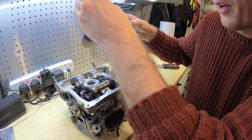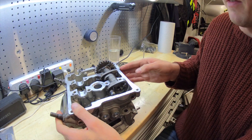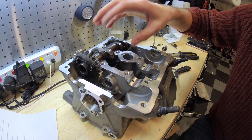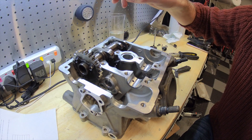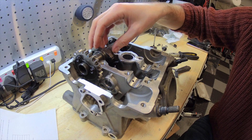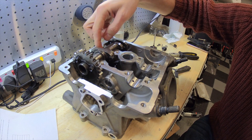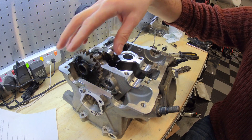On this camshaft I've taken everything out on this side of the engine, but under this one we have the full works in this valve here. So this is our one working valve in this area and everything else I've stripped out of this head. What we've got in here is the valve itself, the lifting collet, the shim on top for the opening, and then we've got our closing rocker here and our opening rocker underneath which I'll show you in a minute when I remove the camshaft.